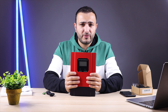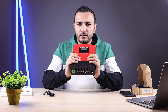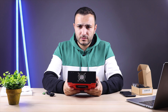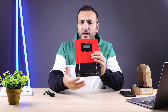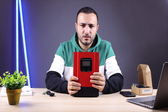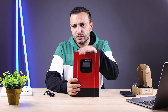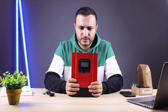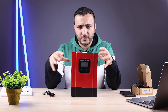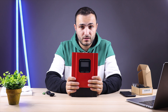The unit is very light and thin. For proper operation it needs ventilation — you can see the fan here, and the fan vents on the bottom. Air flows in from here and is pulled out from the bottom. Don't cover the vents. If mounted in a basement it will stay cool enough, so the fan will only run in rare cases when the unit overheats.